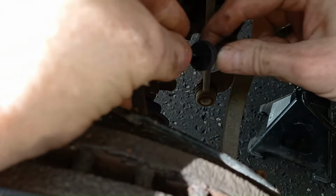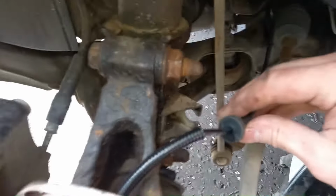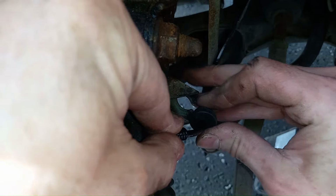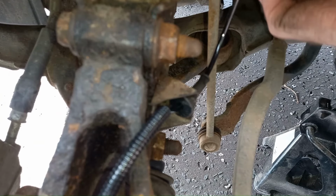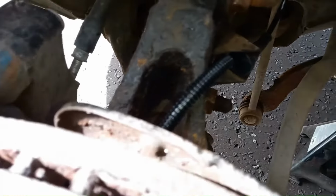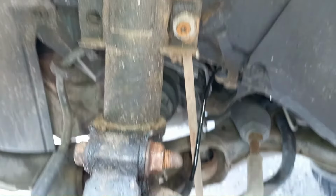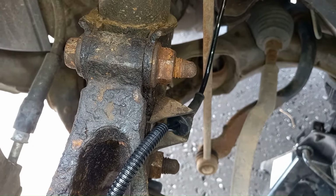Just one last finishing touch before we put the wheel back on, and that's this other clip wire here. And this is kind of what I mean by rolling them in. So if we, you see here, I'm twisting it, positioning it on the bottom, kind of squishing the top as it goes in. Yeah, there you go, nice and easy. So a bit fiddly the first few times, especially if you're doing it backhand like this one up here, but you'll get there in the end. And that's it, that's the ABS sensor replaced, plugged into the top, and hopefully when I reset the trouble code, that'll be the end of the issue.